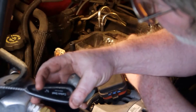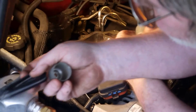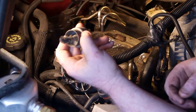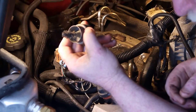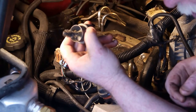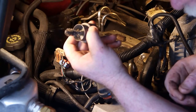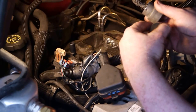I'm using a wire brush — it's half-inch size, though I'm not sure it's exactly the right size. You can use a battery terminal cleaner, a screwdriver and a rag to clean the ports. There are two different sizes on the injector ports so you have to clean both very well. If you use a screwdriver, make sure it doesn't cut through the rag and score the inside of the injector assembly.